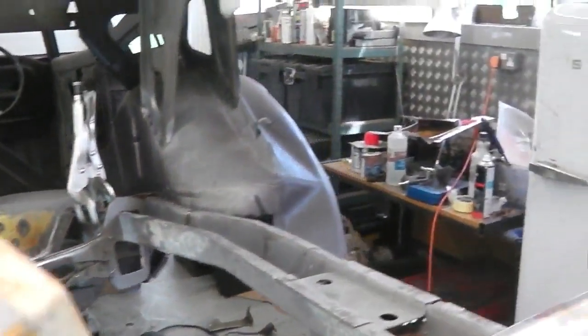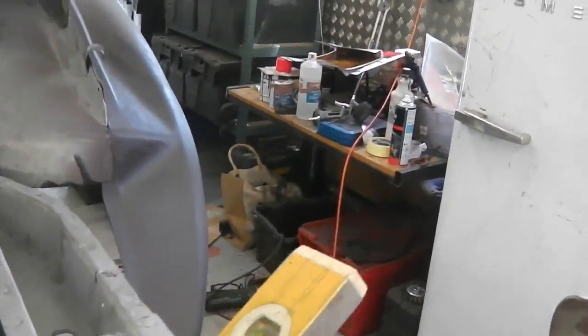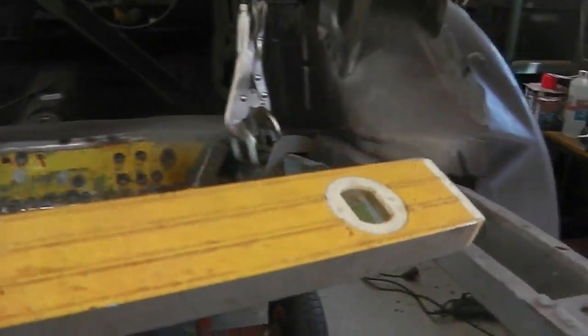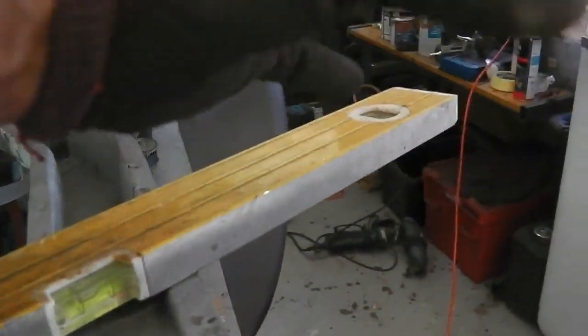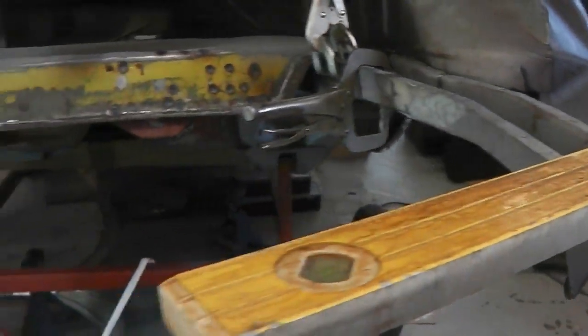I think this one's back, and you can see why. And I bet you've already been guessing it. The filler neck has to come down, so they have to push this. It's not that that one's dog-legged out. It's that this one has to be straight because of the filler cap to dodge the chassis leg. That's what it is. Otherwise, your petrol tank can't get up, and that's what it was for.